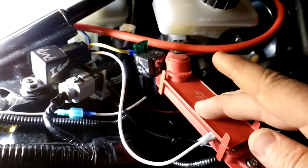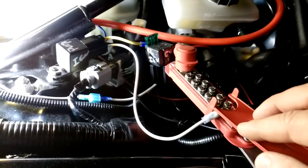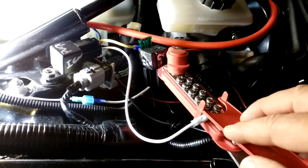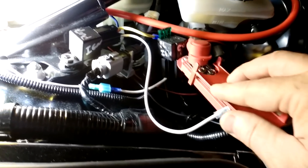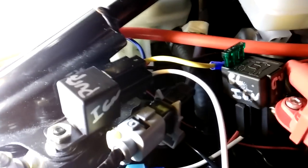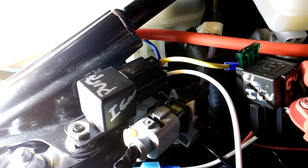There are only four wires associated with the relay, so wiring this up is fairly easy. The blue wire connects to the battery via this fuse — I can then deactivate the system by pulling the fuse if I want to run without water injection. Additionally, there's a wire that takes ignition power. This power bar receives power only when ignition is on, so it's a great spot to connect accessories I only want powered when ignition is on. So: one wire goes to the pump, one to the battery, one to ground, and one to ignition power. That's it for that portion of the system.